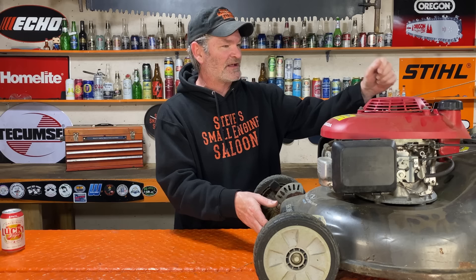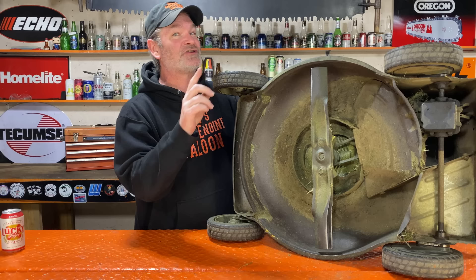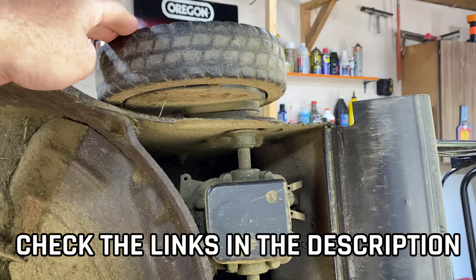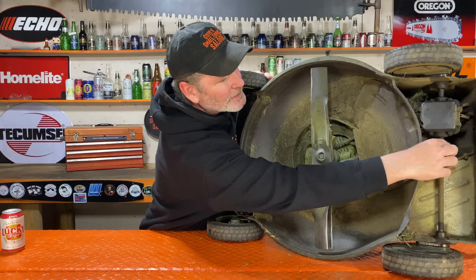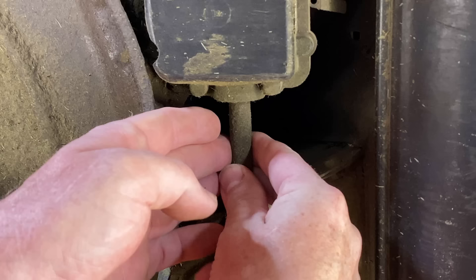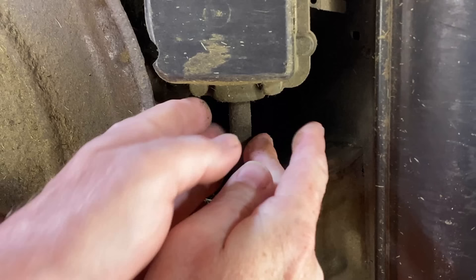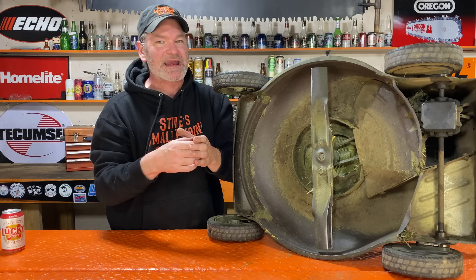Let's flip her over and I'll show you. So I have this tipped over on the proper side now. The carburetor and air filter are up here. We're going to have to flip it over on the other side too in a minute — link in the description and pinned comment for that video. That's going forward — you can hear that ratchet going into gear, nothing wrong with the gear. Spin it backwards and it's really tight. Two hands on here and I can barely spin that axle through the bushing. It's the bushings right here where the axle goes through each side that's getting tight. You get a little bit of water in there, it creates a little bit of rust and starts binding up on you.